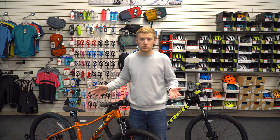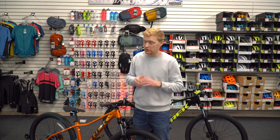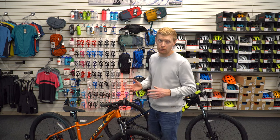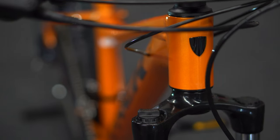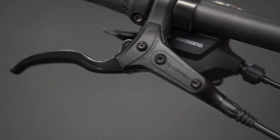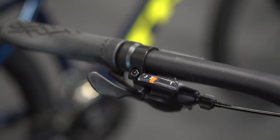Trek's done a really good job with this bike overall. You can trail ride with it — it has a really good front fork. Obviously if you're just starting out you don't need a big double crown like you see on ten-thousand-dollar world-class mountain bikes. For entry-level trails involving bumpy terrain and downhill, the suspension is going to work much better than a Walmart brand. It comes with an SR Suntour front fork, which is a high-quality manufacturer. It's adjustable in a minor way by adjusting the spring tension, making it more responsive or softer as needed.